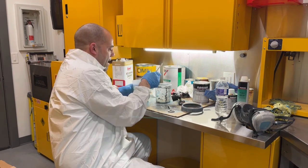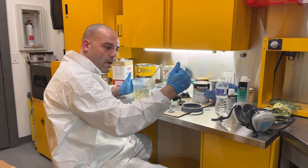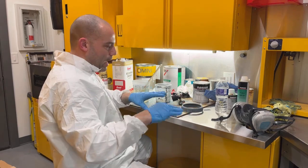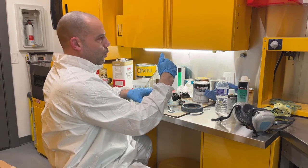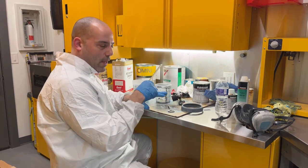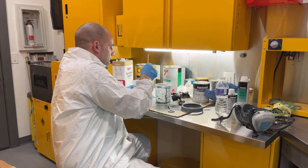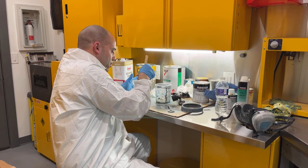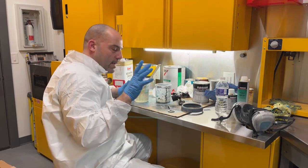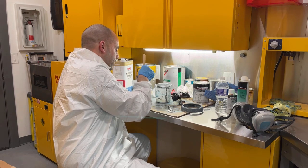You want to try to barely have any orange peel, because what happens is if you have orange peel, especially on the bottom of that fin, and you buff the bottom and you buff the quarter panel out, the top of the quarter panel, and then that fin has a bunch of orange peel on it, or is dry, it actually will reflect onto the quarter panel and make the quarter panel look like it is not wet sanded and buffed enough. So I am going to wait an extra couple minutes longer than I normally would between coats, because I'm going to try to get that to really get sticky between coats of clear to try to minimize running.